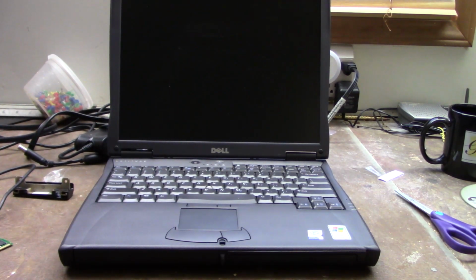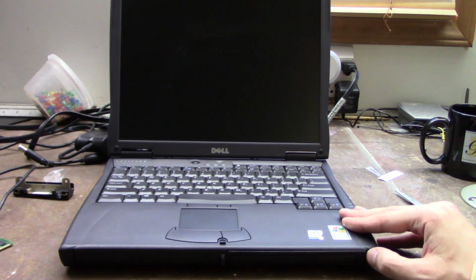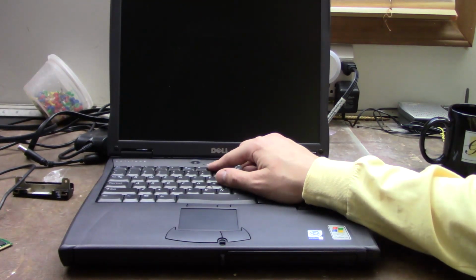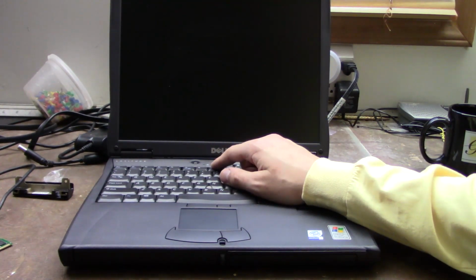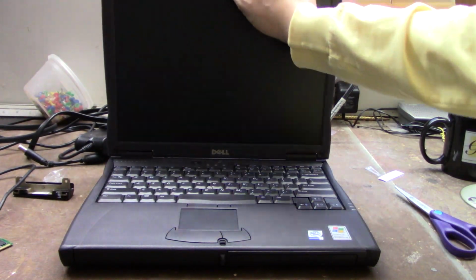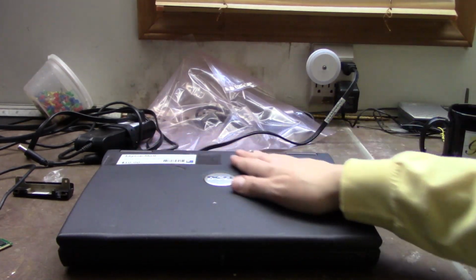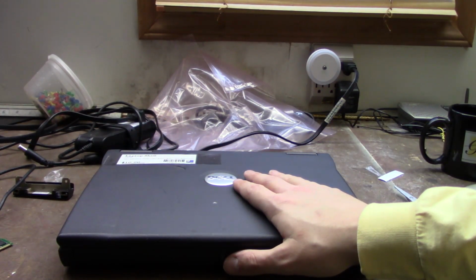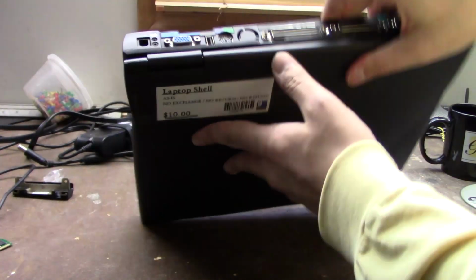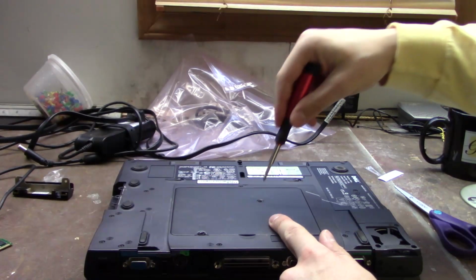So, in this video, we're going to attempt to get this up and running. I don't know if this works. I know it does at least give me an error code via the caps lock key when I turn it on. It blinks about 9 or 10 times indicating a RAM error, which is because there's no RAM in here. So hopefully this computer will come to life, or else we really won't have much of a video now, shall we? So first thing I want to do is pop the bottom off here,